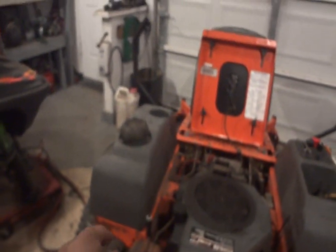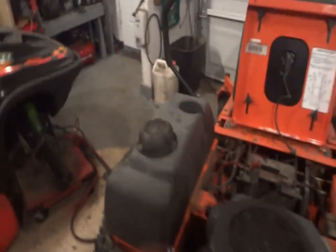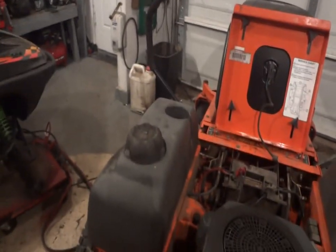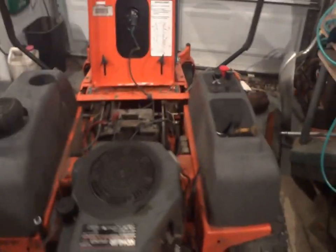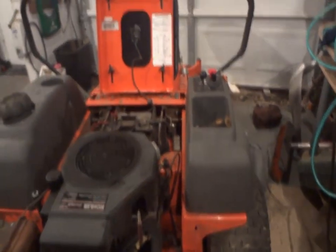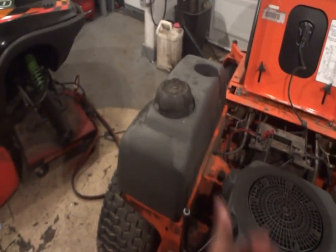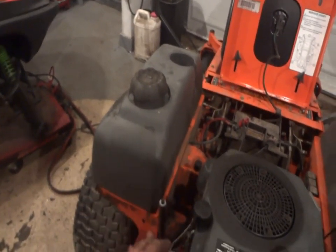I've already drained it out. What I did was use the little air pressure piece and blew it in there. I used a vacuum, sucking the shavings out just in case, so I wouldn't get any shavings inside the block, because I wasn't going to take the whole block off and drill from the inside and then have to buy a new seal down at the bottom. So I drilled it right there in the block with the vacuum sucking all the shavings into the vacuum.